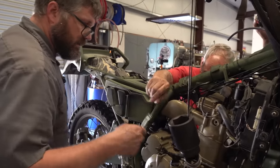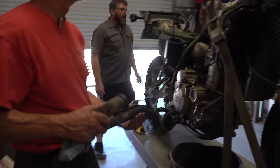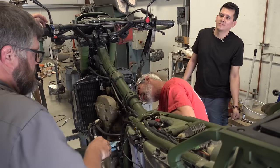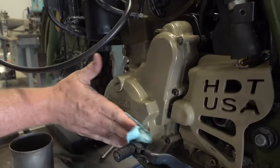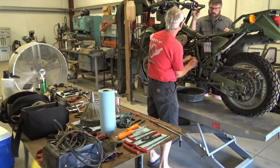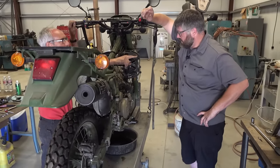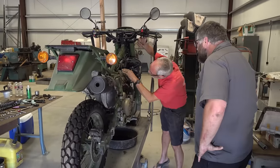Getting close to this thing firing up. The system is primed, timing is set. Rick shares a tip: if you ever change the fuel filter, when you fire the bike up bring it to 3000 RPM immediately and let the fuel flow through. If it catches air, you're done and you'll have to go through this whole bleeding process. Most people freak out and take it to a mechanic who says it's a bad injector — a thousand bucks to fix — when it's actually a pretty simple fix. It takes three men and a monkey half a day to prime a diesel KLR.